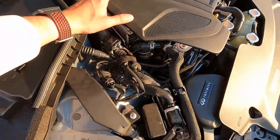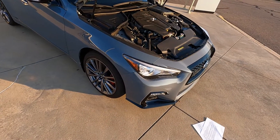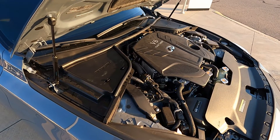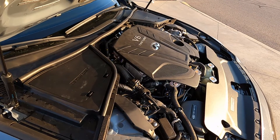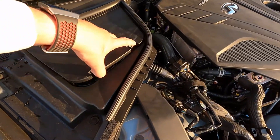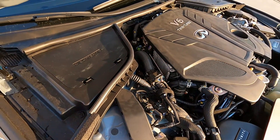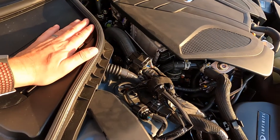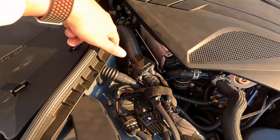This is the shock tower — look at the engine, it's actually pretty far back. Weight distribution is still front-biased, but just barely. Also notable is the double engine compartment bulkhead: a second bulkhead at the rear of the engine compartment serves as an additional cross member. What they actually do is place the battery in here, which isolates it from heat and improves weight distribution, and also keeps your battery terminals clean. Much like a strut tower brace would increase rigidity, so does this double bulkhead.